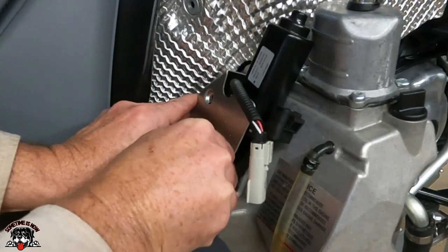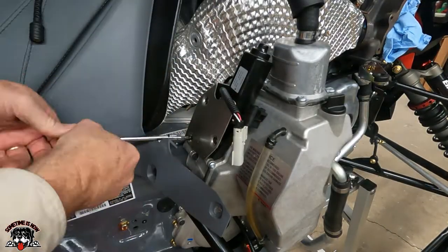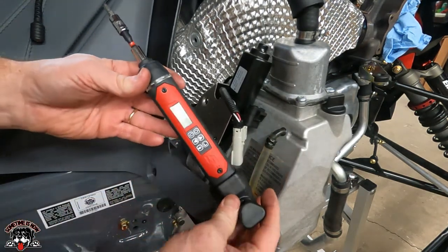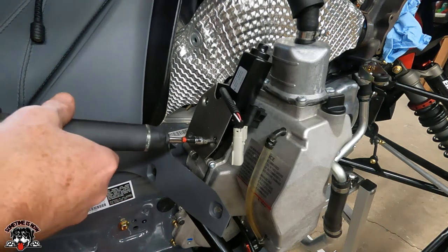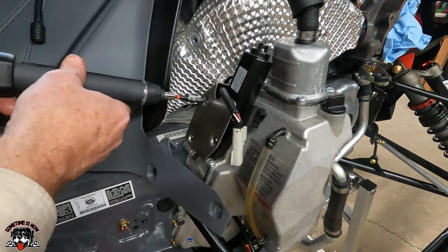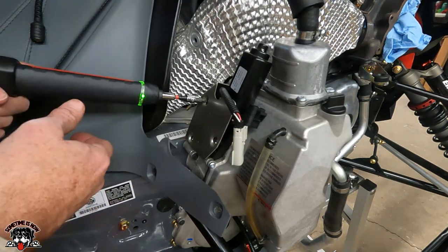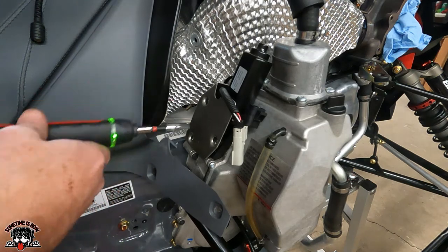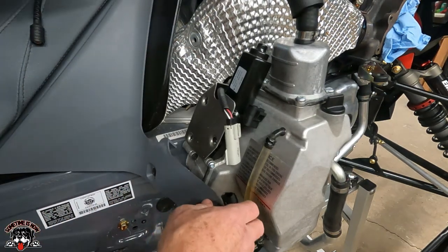And these will be torqued to 36 inch-pounds or 4 Newton meters. There's no Loctite on them screws, so I'm not putting any back on it. All right, so we have it set at 36 inch-pounds. So we'll snug them up evenly. And this case is just delicate, so I'm assuming that's why 36 inch-pounds is more than plenty, I'm thinking. 36.2, 36.6, 36.9.